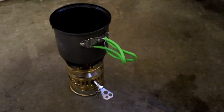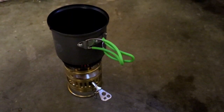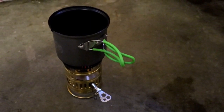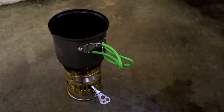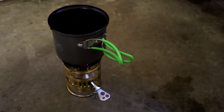And then once I got it lit, I put the fuel pressure just a little over empty. Don't do it full max. If you do it full max, it kind of wants to stall out and sputter. If you do it just a little bit above where you start, it does this nice purr and it regulates nice.